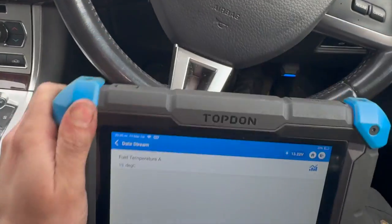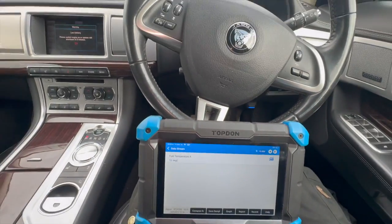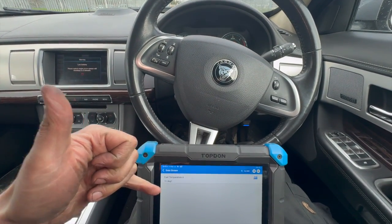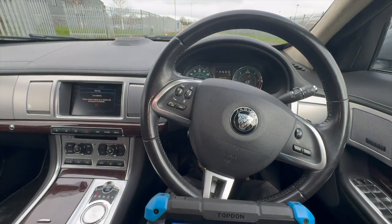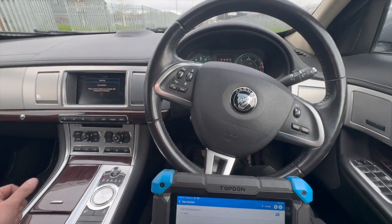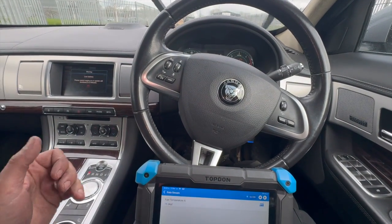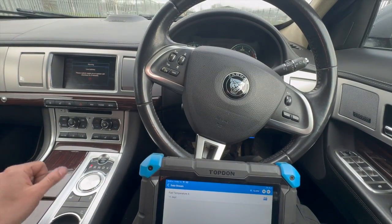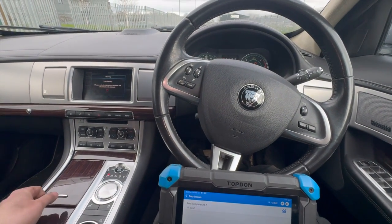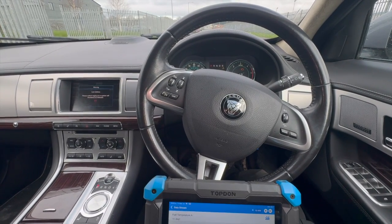That was all it was - down to a faulty sensor. It comes as part of the pipe but it's not too dear - I think it was about £45 for a genuine one from Land Rover, and I'll put a link in the description below. As I said before you could clear the code and it might take a few days to come back, but looking at the data the temp was always wrong. Now that it's reading correctly, I hope the video helped. If the sensor is disconnected it should default to minus 40. If you've got the same fault code, it's well worth checking into. Give it a thumbs up and subscribe to the channel - thanks for watching.